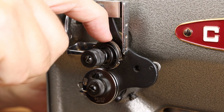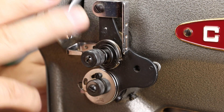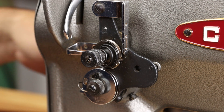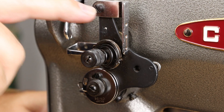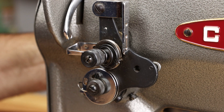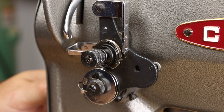If you're unable to set the tension because of a mechanical issue with the tensioner, it's a lot like trying to sew with your presser foot raised. When the presser foot is raised, these discs become loose — there's not enough upper tension to balance out the stitch in your material. Make sure your foot is down and the tension assembly is in good working order.